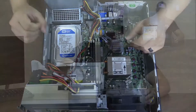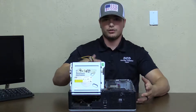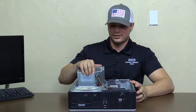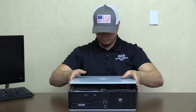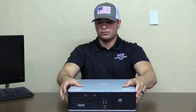And don't be afraid to push really hard — they do get stuck in there some. Once you do that, you can close down this. Make sure the cable's not in the way, and then you push down on the power supply. And you've changed the RAM. We'll get the lid now, line it up on the back here, give it a little give, push down, push forward.